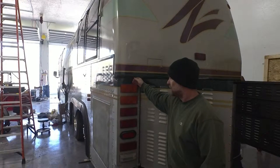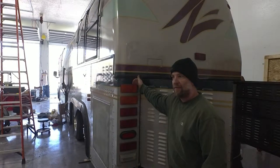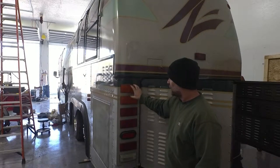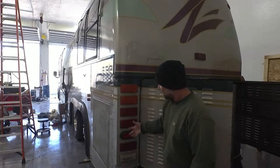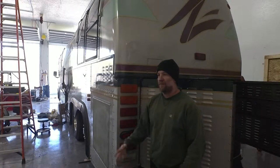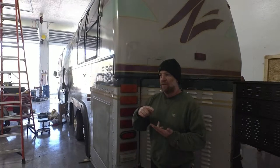This is a 1981. One of the issues we ran into in these buses, and probably a lot of the older buses, is their wiring — they're called a three-wire system. Basically you have your turn signals, parking lights, and brake lights each on a separate wire. When you go into newer cars, trucks, and especially trailers, you're on a two-wire system where tail lights, signal lights, and brake lights are combined.